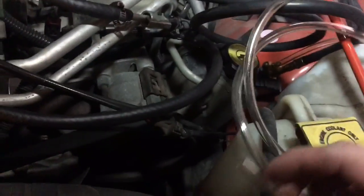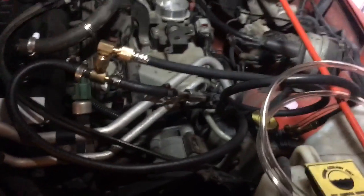Right here is the little quick connector that adapts it to the fuel rail. Put a clamp on that and make sure you clamp these well, because this system is supposed to have 45 to 55 pounds of pressure. Now you'll be able to kick the engine over or just turn it to the ON position, bleed some fuel out, and read your pressure. Hopefully that helps everybody out.